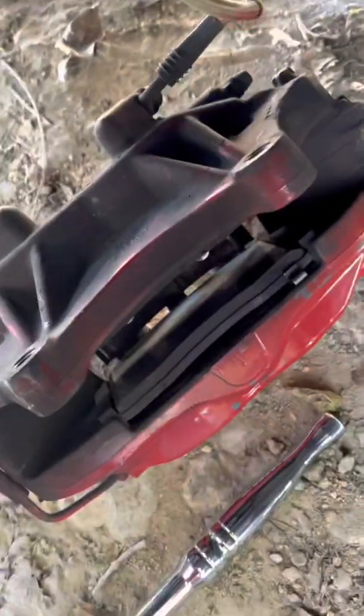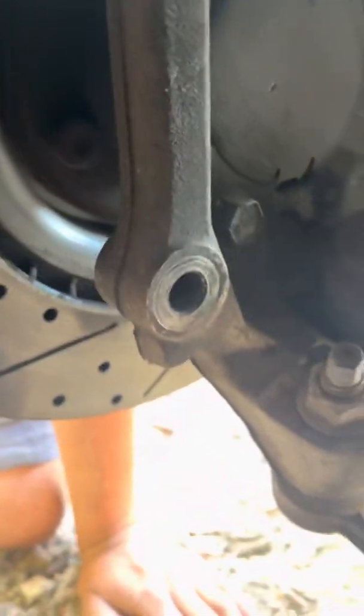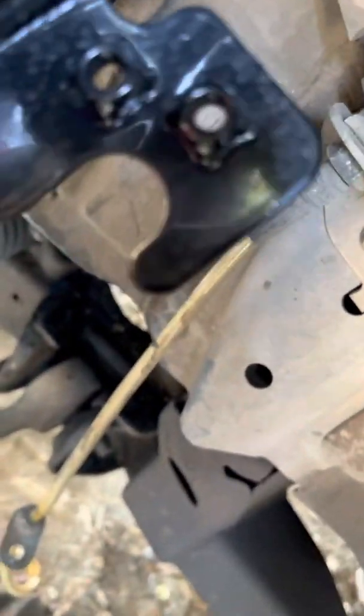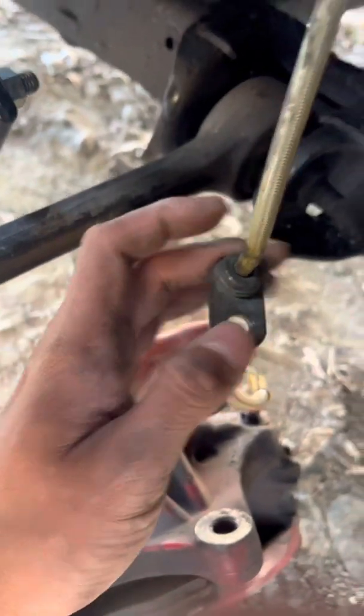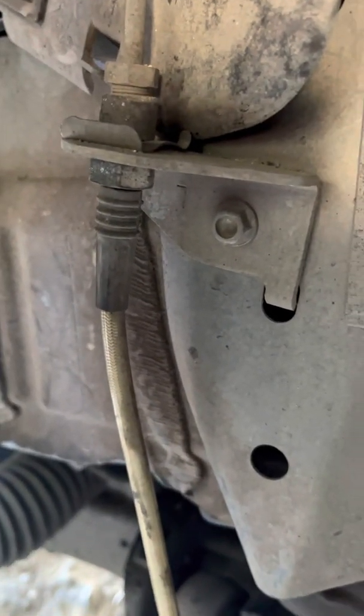This is about getting the old caliper removed. There's going to be two 18-millimeter bolts going through here — the corresponding holes are right here and right here. There will also be a 10-millimeter bolt going through here, holding the remainder of the brake line. Then the next step is going to be removing this brake line from the actual connection that's made into the car.